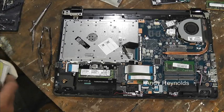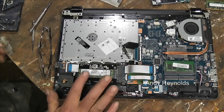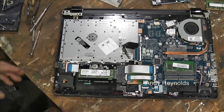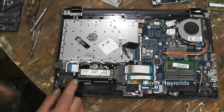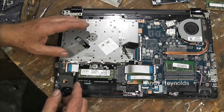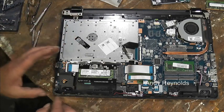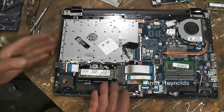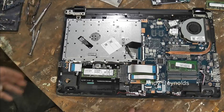All we do is reverse the process: put the top on and put the screws in — it is that simple. Some earlier models are really difficult to get into, but this one with the right method: take the battery out, make sure you've got all the screws out including from underneath the rubber feet, then ease it gently and once you get halfway round it just pops off. Make sure you fold it so you put the top down on the deck and then lift the bottom off.